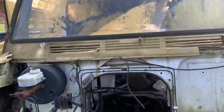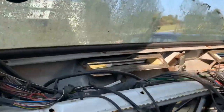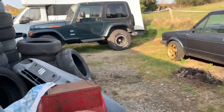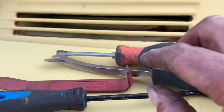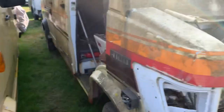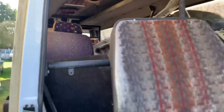So what we're going to do then is — obviously this is a scrap vehicle, but I need the bulkhead for our current camper van. I'm going to pick this rubber out from the inside. Generally, the rubbers are quite hard to get these days and the windscreen's quite valuable, so we're going to gently fold the rubber in from the top corners, work our way round and then hopefully it should pop out using a range of sensible, ideally plastic tools — because as we all know, big sharp screwdrivers and windscreens, if you're silly, it's not a good combination. But I need to push the corners in with something more substantial and then I just use a little rubber trim tool to push the outer edges back in. We'll start from the inside first. I think it's probably best, but I might have to move some stuff because this old bus is a bit of a mess.